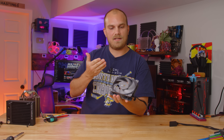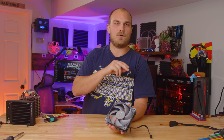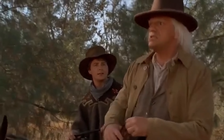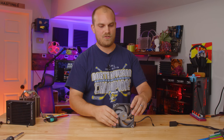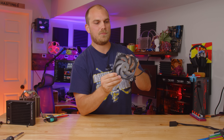Some of the more notable components are the dual vapo bearings and the magnetic levitation technology. The vapo bearings are a proprietary design created by Sunon for cooling fans, designed to eliminate wobbling and reduce wear, allowing this fan to run quieter for longer — which is always a good thing in PC cooling fans.